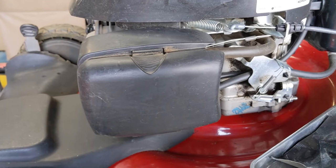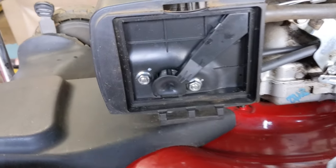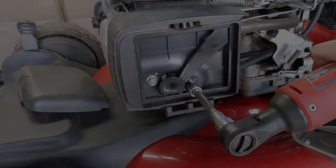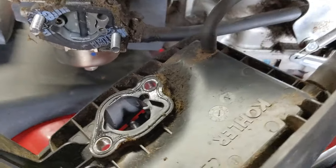I've pulled the mower into my shop now. We're going to go ahead and remove the air filter cover. It has a brand new air filter installed on it and down here we have two 10 millimeter nuts that we're going to remove. Once you remove those nuts you can disconnect the breather tube as well as the fuel tank vent tube back here.